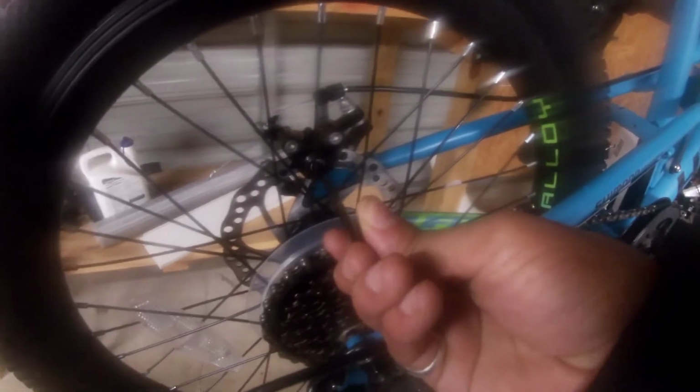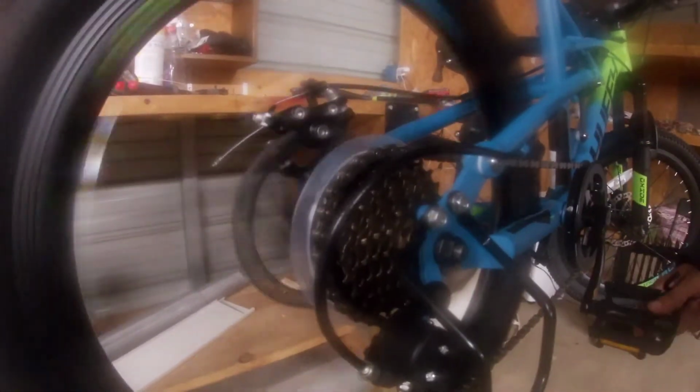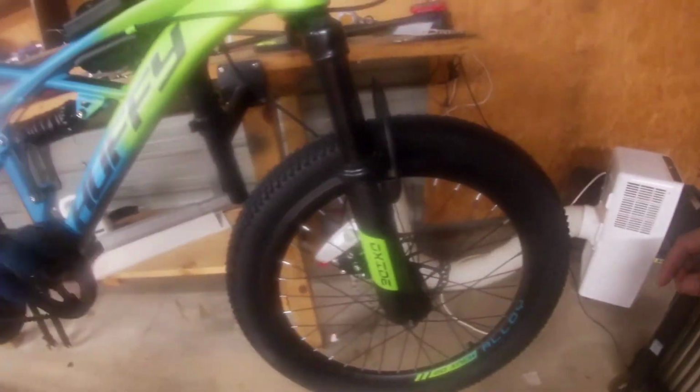There's Makai going on to put the left pedal on. He did a good job of that. Now we are over here adjusting the brakes. Everything is on. This right here pulls that brake out. This brake was rubbing in the back a little bit, so it pulls that brake out, gets it spinning. When you adjust, you have those 3 things to adjust the calipers and the pads and everything. Those 3 screws right there that you see, those adjust your brake.